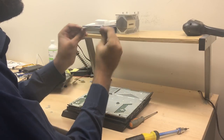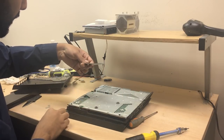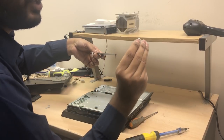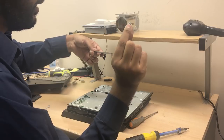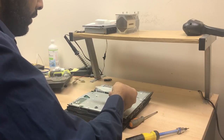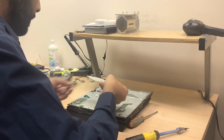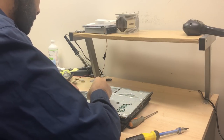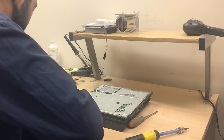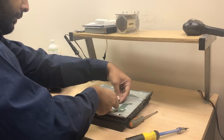What we're going to be doing is removing these screws and adding two washers underneath so that we have more pressure onto the APU chip, so it will make contact again with the motherboard and start working again. Go ahead and remove the two Phillips bolts. Once we've removed the bolts and have the brace in hand, we're going to put two of these washers on each side — two here and then two here. These are the washers we're going to be selling on our website. Put two on each side, same thing on the other side.